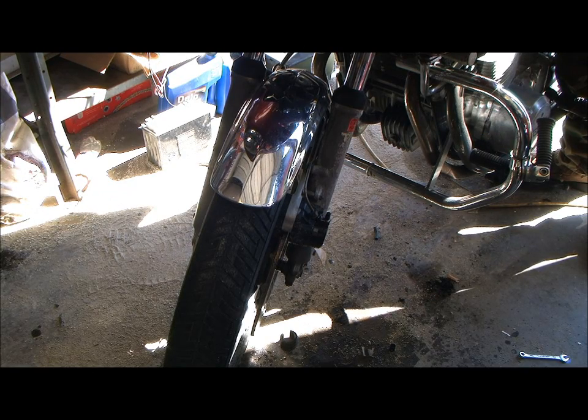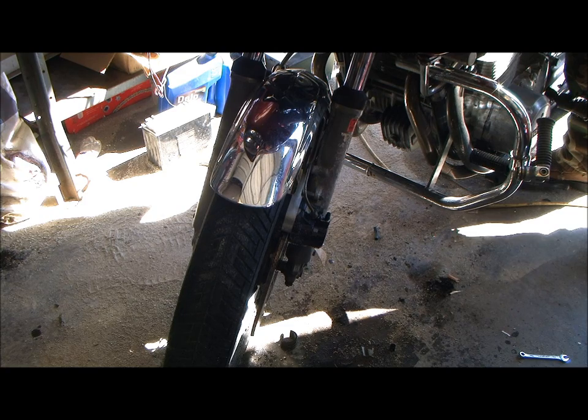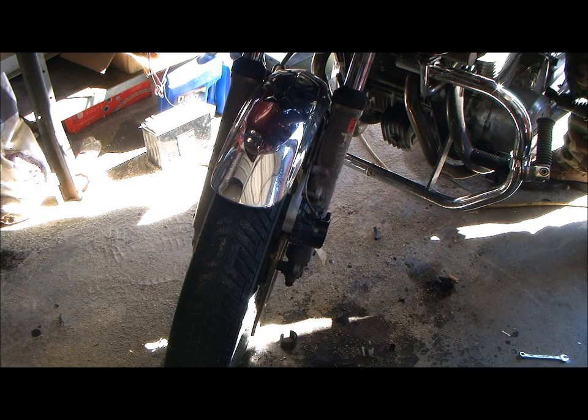And you can see it's locked down there, and I can go ahead and tighten it because he had to order his brake pads. I'm kind of surprised at that because South County is usually really good about brake pads. And I pulled chunks out of the return hole on his master. Probably something stuck in the line, huh? Well, yeah, that's why I had to get the spray cleaner. I filled your master with spray cleaner already.